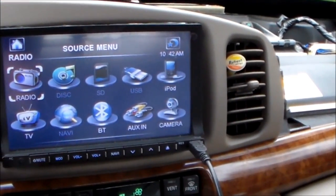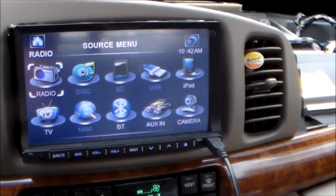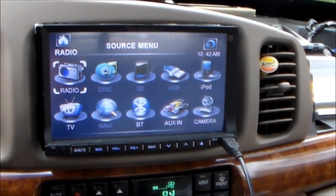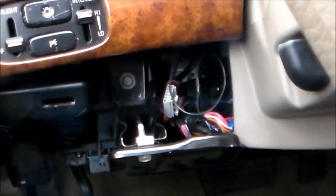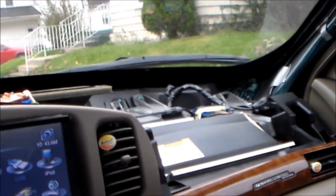Because when you're parked and you don't have your car running, you want to listen to some music, you turn the ignition back to accessory. Well, the stereo wouldn't work. So I had to come over here and down under there. And right in there, oops, sorry, smoke. Right in there, I had to tie into the windshield wipers, because they will work in both the run and